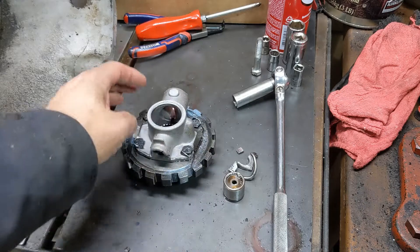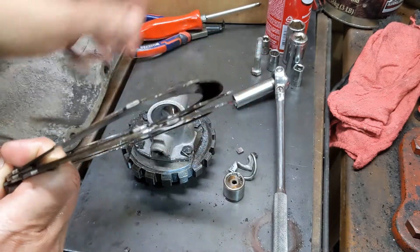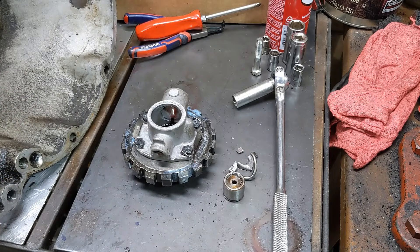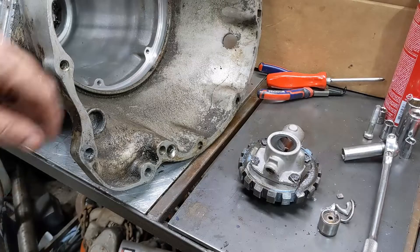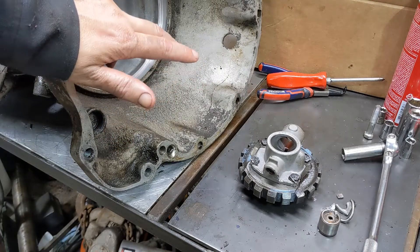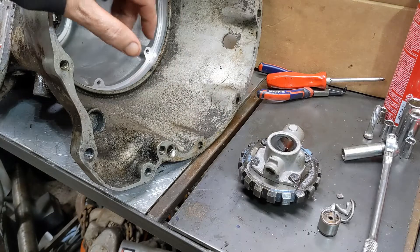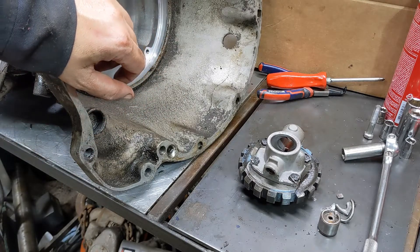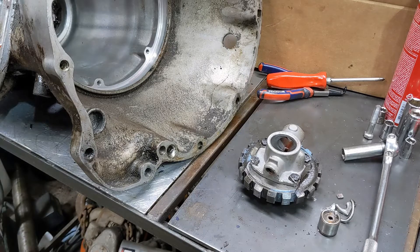So it looks like the governor completely came apart. Another problem was the rear clutch — it certainly overheated and cooked, though I don't think that was causing the failure, but it was probably causing some problems. And then lastly, we had an idiot trying to take it out with a pry bar with a bolt still in it, which cracked the bell housing. Since these 727 cases are all one piece, that crack makes reusing this thing questionable in my mind. If I had no other option I'd probably just braze that up, put it back in and send it. But I'm going to look around and see if I can find another one, because I still need a core to go behind my 5.9 Magnum. We'll still try to repair this just as a video to see how it looks and see if we can do it. Thanks for watching.